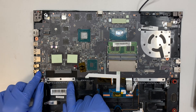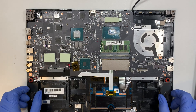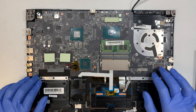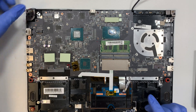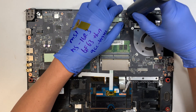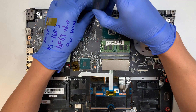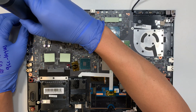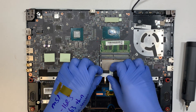To remove the speaker or replace it, just lift it up and there you go. Now I need to remove the motherboard and show you how to change the keyboard if it's replaceable. Let's go ahead and remove the motherboard first. There is one screw on the top, a second screw, and a third screw — it looks like there are only three screws attached to the motherboard.